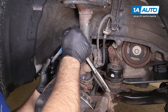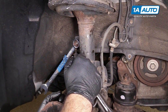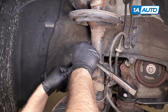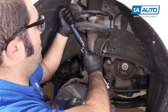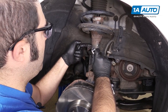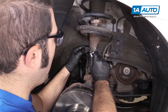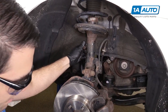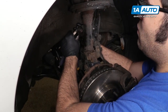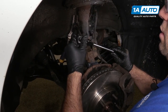As I kind of expected, working these back and forth, this hex drive basically always strips. It's nearly impossible to remove them without these stripping no matter what you do. So the next step, I'm going to get some vice grips and try to hold the ball joint back here and use a 17 millimeter socket and ratchet to continue removing this nut. I'm going to try to slide these locking pliers behind the ball joint on the sway bar link. I've got a 17 millimeter deep socket on this longer ratchet.